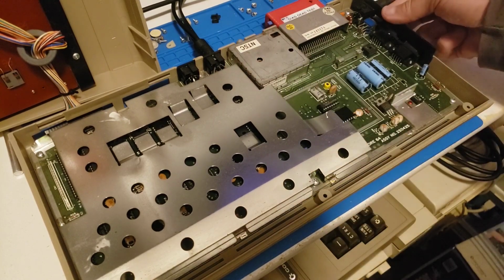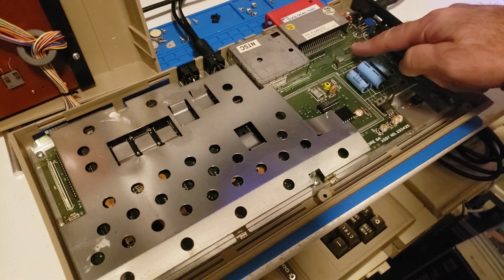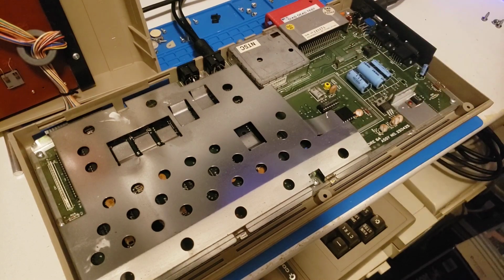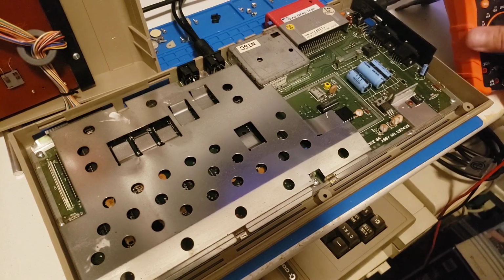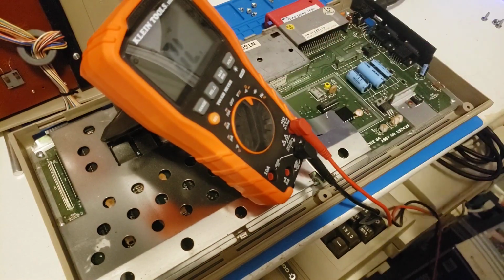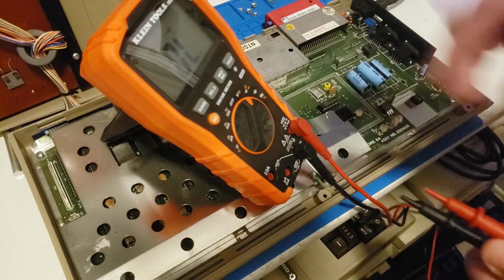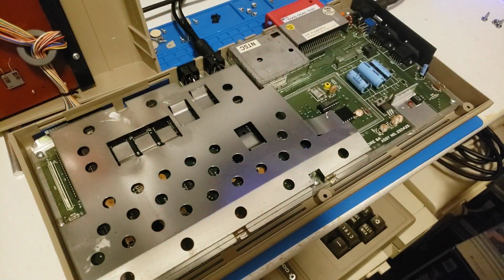That's dead test right there. Again, you're getting 5 volts, you see an LED, and nothing comes up on the dead test either. No signal. So first things first, when I don't get a signal, I look at the fuse. I've got my tester here, and first thing I'm going to do is tone out the fuse. Okay, that tones out, so I know the fuse is good.